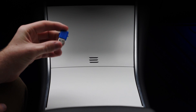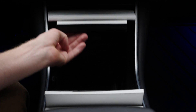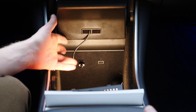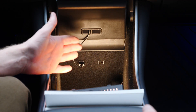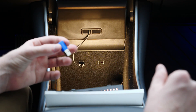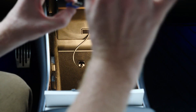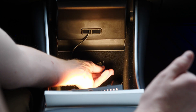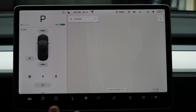Here's the center console. I've got my recently formatted USB right here. You'll notice that a cord is already here — that's for my cell phone. This whole left side, the driver's side, does not have data capability, so if you plug in on the driver side you are not connected to the car's computer system. So we are going to put the freshly formatted USB in the right side, the passenger side.